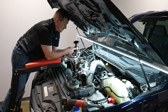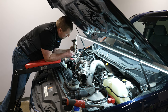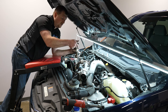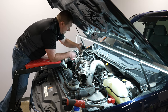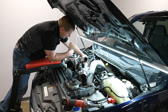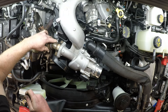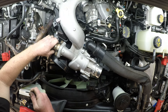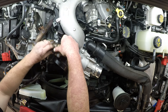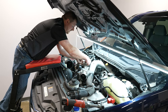Next, put the EGR tube back on. Make sure at least where your gasket is going to seal is cleaned up. These gaskets retain themselves — bend the ears down a little more if they want to fall off. The temperature sensor goes towards the fan so you can plug it in. Underneath the plenum, that's the connector that's a little tricky to slide off. Line it up — there are four 8mm head bolts. Get the EGR pipe reinstalled and then move on to the next component.